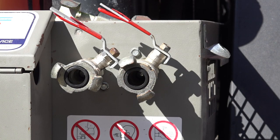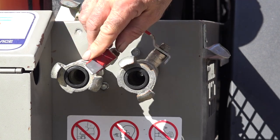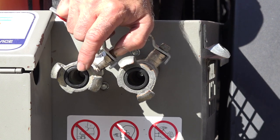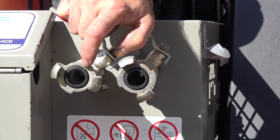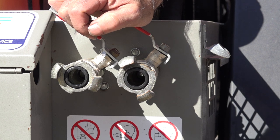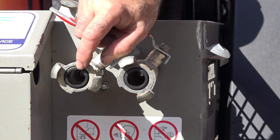What you saw while we were running up the compressor, it was holding up pretty well. It's 7 bar, but as soon as we opened up this valve here, you could see it dropping down, and it was fully open. It dropped down to about 5 bar, because the orifice, or the opening, is so big that the compressor couldn't keep up with the volume and it had to drop the pressure. It's a bit the same thing with a nozzle. If your nozzle is fairly big and your compressor is not powerful enough, you're not going to get the pressure and you're not going to get the airflow. Now of course, if we go into blast, we have a 3.5 mil nozzle, which is a lot smaller than this, so this compressor will just do fine.